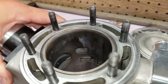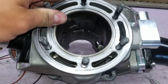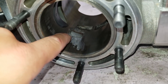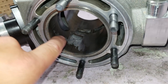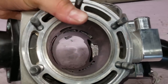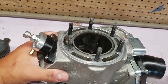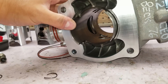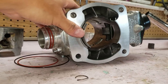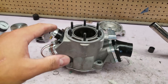I'll try to give you guys a good look in this cylinder — it's really not bad. There's a little transfer right there from the piston, and over here is the spot that looks so bad, but that's all aluminum from the piston. You can feel it's raised up, so we should be able to get rid of that, and the rest of this actually feels pretty smooth — I don't feel any gouges or anything. This is also a sleeved cylinder, which is a little bit more forgiving than a Nikasil cylinder, so I think we're gonna be okay.